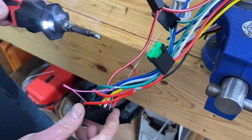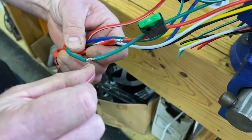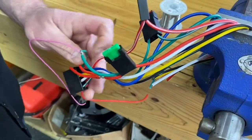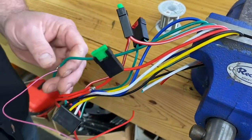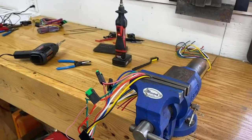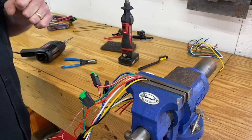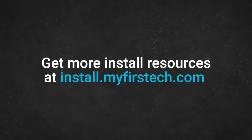You'll see that connection is now soldered and very solid — you cannot move that wire. If you guys have any suggestions or tips, please post them in the comments. There is no perfect way; everyone has their own way to solder. Just know that it does take extra heat to suck that solder into the wires and make sure they are fused together. Guys, stay safe and have a great day. I'll see you next time.